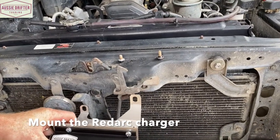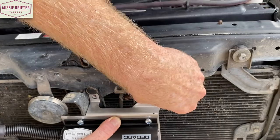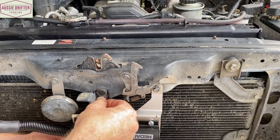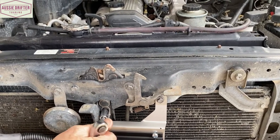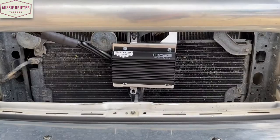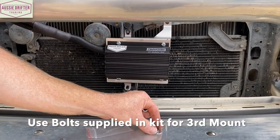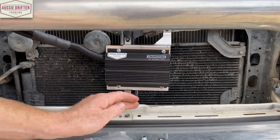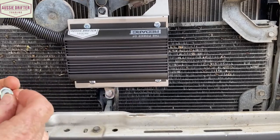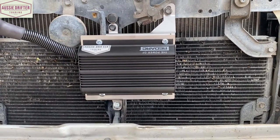Now we can sit our charger into position. You'll see it matches up to those bolts we've just taken out, so we can go ahead and reinsert those — probably just finger tight for now until we get that third one in. We've got those two started, and you'll notice the third bracket mount down here actually lines up with a hole in the Toyota grille support. In the kit you've got a little packet with a bolt, a nylock nut, and two washers — this is our third mount of the bracket. Using the bolt with one washer, going through the hole, and on the back side using the washer and the nylock nut. At this point we've got all three mounts finger tight.